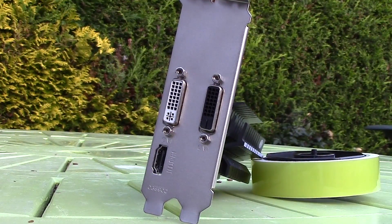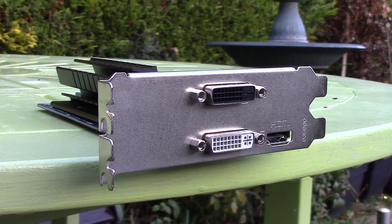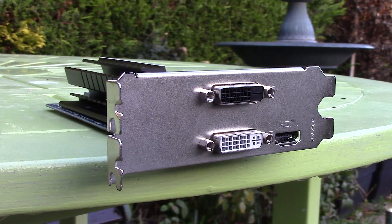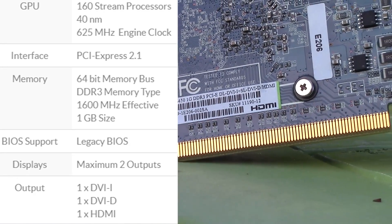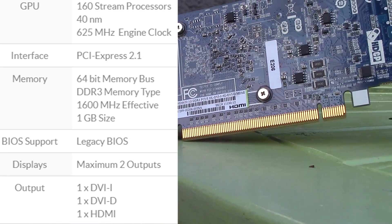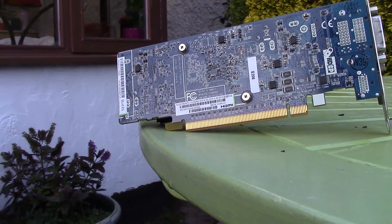This time it's the turn of the HD6450, one of AMD's cheapest graphics cards that can still be bought new. This one is the Sapphire Flex version and features 1GB of DDR3 memory, 160 stream processors, and support for DirectX 11. AMD also recommend a 400W power supply, though it has no additional 6-pin power connectors so will probably run on a lot less just fine.